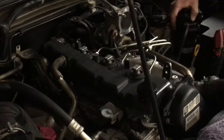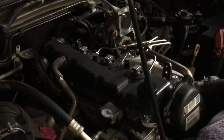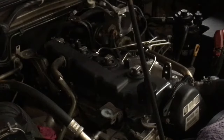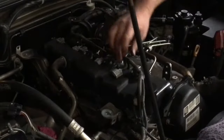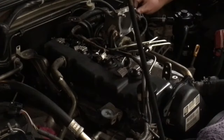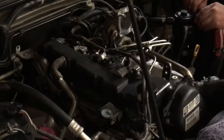And now that the fuel system's sealed and it's back in place, the first thing I want to do is start pumping it up. Because that's hard, it'll go soft again and it'll bleed through a little bit, and it does save a bit of time getting it started if you do that. Okay, now this wiring loom again. Made a point that we didn't need to strangle it when we moved it over there out the way. Just going to manipulate that back into position. Clip goes in there, and then that plug goes there, and then that plug goes there. It all just falls back into place. You don't have to worry with all the plugs, just follow and go, yeah, that'll be on the intercooler. This is for the fuel filter, so we'll plug that back in.